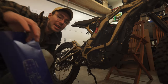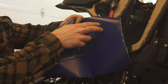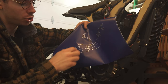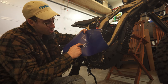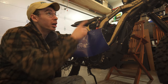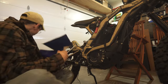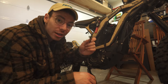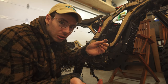Okay, now that we've run all of the wiring, I drew up this little diagram. Basically, we're pulling power from the bike — that's coming out of this little plug right here. Red and black will run down to the light itself, so that way, when the bike is on, it's always illuminated. Then, on the yellow wire that makes the light flash, we're gonna run two different switches: one is the brake that we just wired in, and then in line with that, we're also gonna add one of these little inline switches, so that way we can turn off the flashing annoying thing, just so we don't get in trouble.